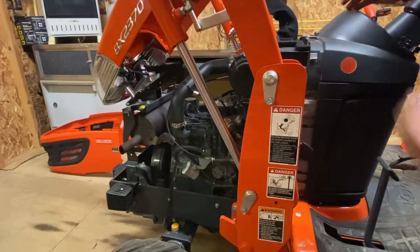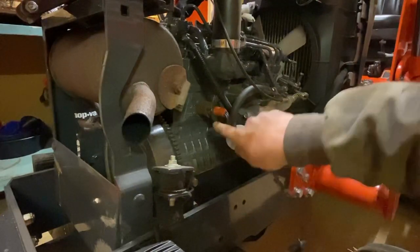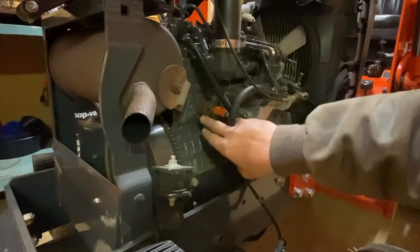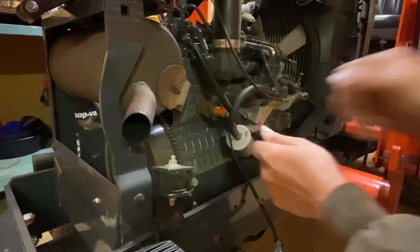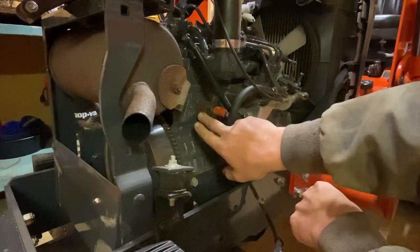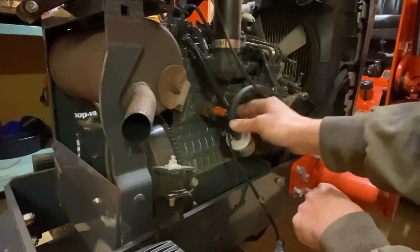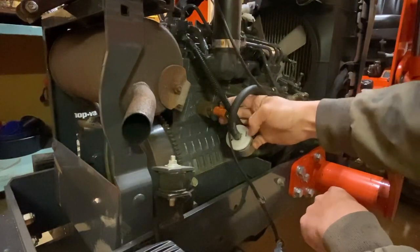Then you can release your hood all the way up. Now that we've got the hood up and the bonnet off, we can see the block heater. It's on the left side of the engine block. This metal piece is actually pressed in — the first thing you do when installing one of these is knock out the freeze plug using a screwdriver and hammer or chisel. Gently tap it to rotate it, then grab pliers and pull it out. There's a metal adapter piece you tap into the block, make sure it's fully seated, and then there's an orange plug you push in with a little green collar that snaps over it to hold it tight.